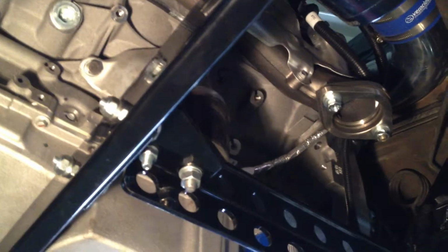Another question was asked about somebody wanting to think about doing turbocharging already, and where would be a good spot to put a turbocharger? Well, the driver's side here is going to be a little bit tight. By the time I've got the water pump bolted into place, that's where the electric pump sits on the cross brace, but you're going to have a bunch of hoses coming off of that back here. So I'm sure you could do a small turbocharger right here, or the other side if you just want to do a big single.